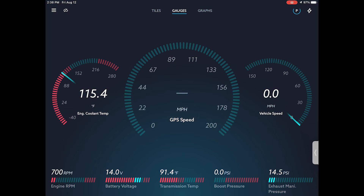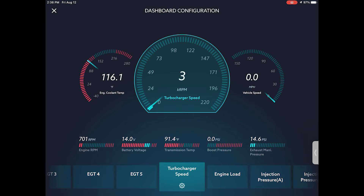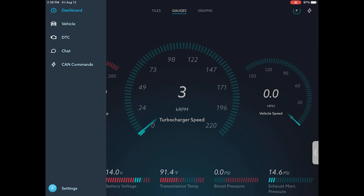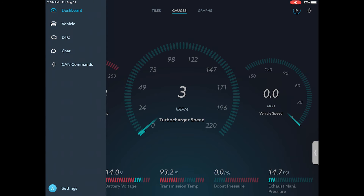If you wanted to set it up as a gauge screen setup, you can totally do that. To change through the gauges, just touch it. You can throw turbocharger speed up there, which is nice — really, really cool and very highly functional. One function you get from this is the ability to read and clear diagnostic codes. To do that, you just come out to the DTC list right here, and it's automatically going to read codes. It's got a C0020, which is an ABS pump motor control, and you can clear the codes from there as well.